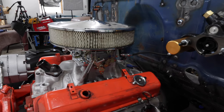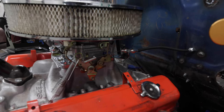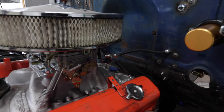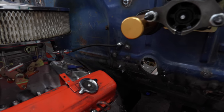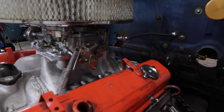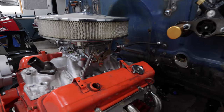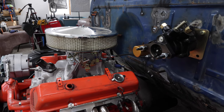One of the things that did work out really well is the gas pedal linkage. This is just a universal kit — I have it really clean. You can see where it's coming through the firewall right there. It's a cable pull and it just cable pulls real nice straight over. The linkage is all dialed in with my return springs and things — just a Chevy 350 with an Edelbrock carb — just real clean linkage there.